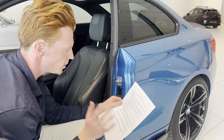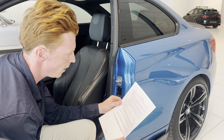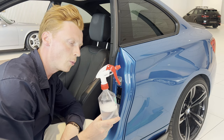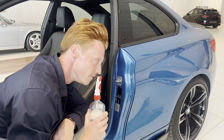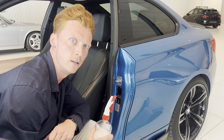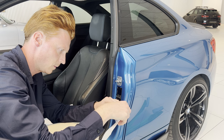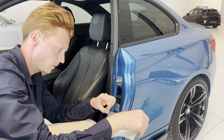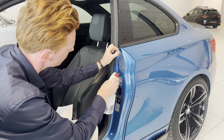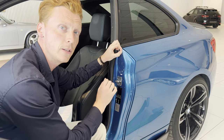For the wet application, spray the open adhesive side and the surface to be covered with the film with low surface tension water — that's water plus a few drops of baby shampoo. Here's our lukewarm water with baby shampoo — oh, reminds me of daycare as a kid. So then we're going to get our protective film, carefully pry one off, and spray it down.